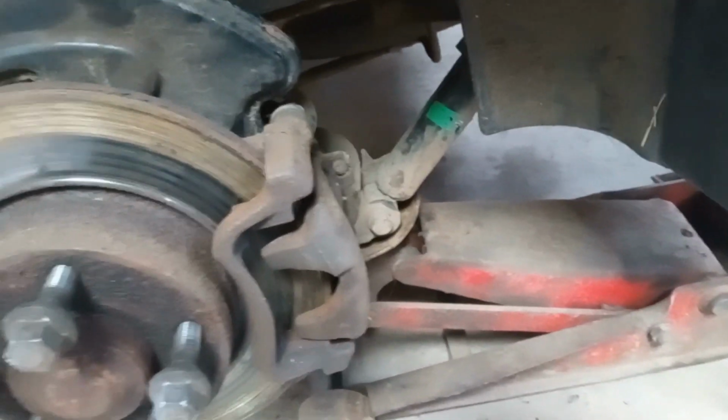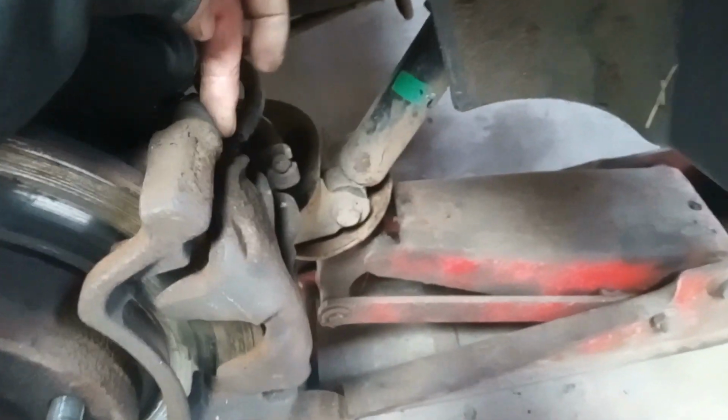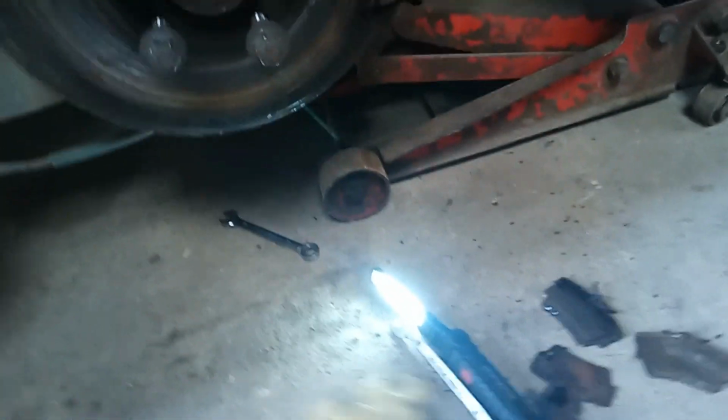Okay. Well, the sliders all feel good. See, these things, the sliders, they need to be free moving, top and bottom. Yeah, they're fine. Otherwise, you're going to get a seized caliper. And it's not going to be the caliper, it's just going to be the sliders. So it's good maintenance. Every time you take a brake off, give them a good, decent oil up.